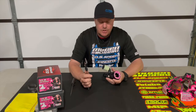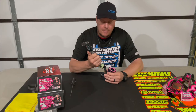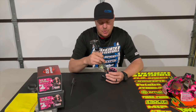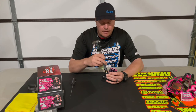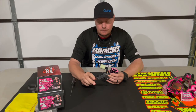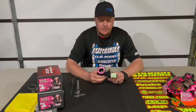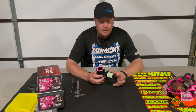For the high speed adjustment, this is where you'll probably see the most variance. When measuring, make sure the caliper doesn't fall down into the slot — measure across the head of the screw. For the high speed needle, you want to be in the range of 1.3 to 1.45 millimeters in from flush.